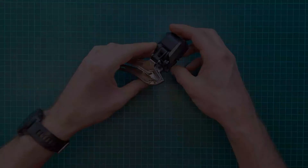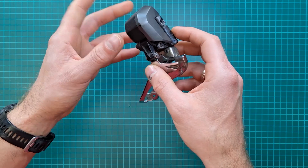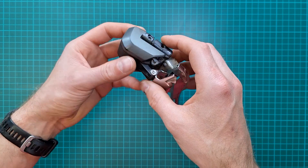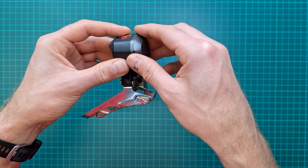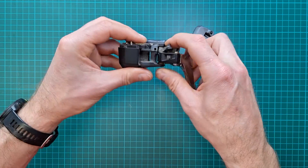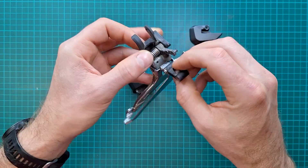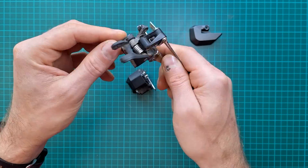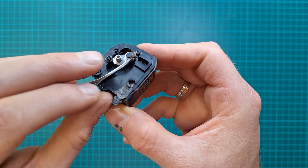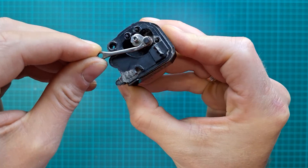In the first part, we're going to take apart the servo of the GRX front mech. I'm going to show you what's wrong with it from the outside and potentially what caused the issue in the first place. Everything is moving nice and smooth here, so no issues whatsoever. But if you pay attention to that bit here, it's very rusted and as you can see, that doesn't move.